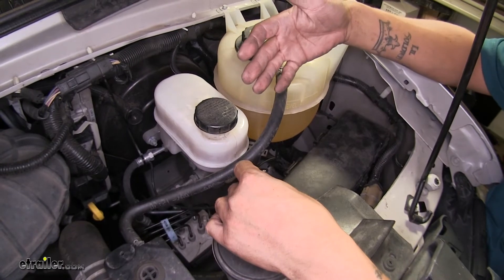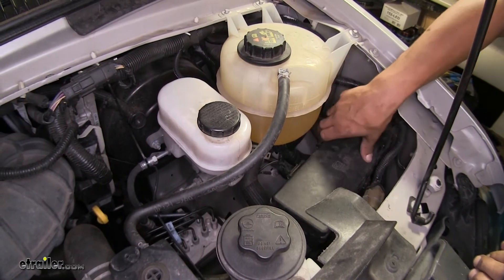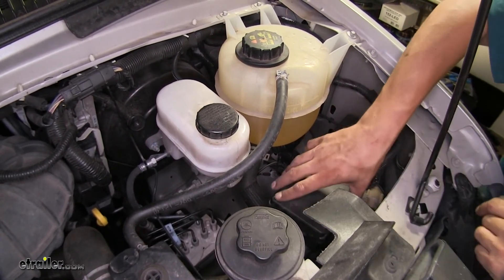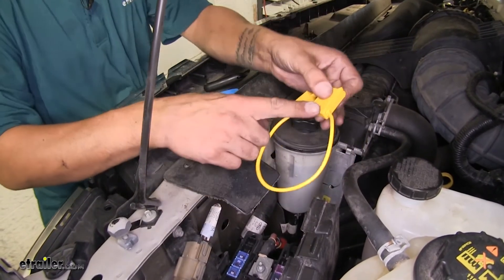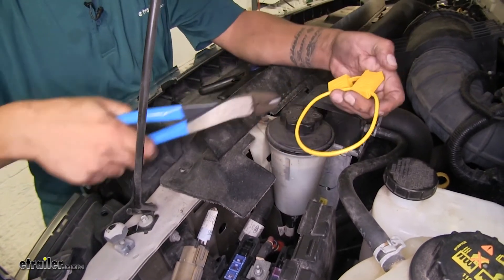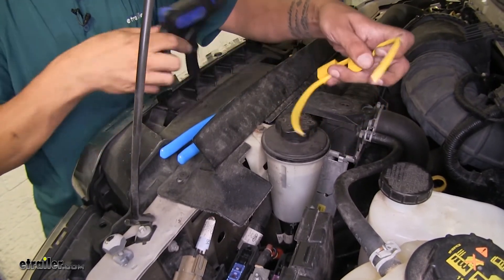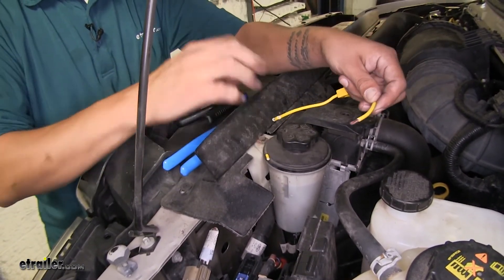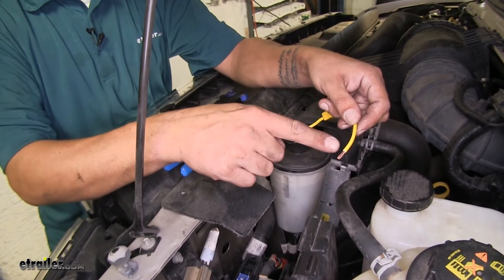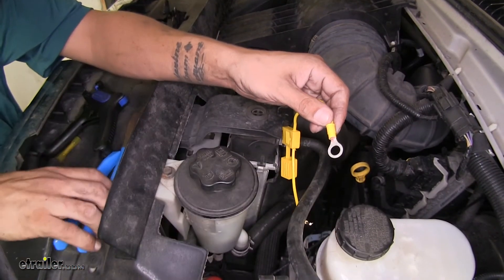The battery is on the other side of the engine bay, but fortunately right here on the very outside front of the driver's side of the engine bay, we have our fuse panel. If we come to these two clips, we can release them, open up the cover, and we'll have a 12-volt power source right here. Before we hook up our wire, we're going to need to put our fuse holder in place because it is a fuse-protected circuit. It's one big loop, so I'm just going to cut it directly in half and strip back both ends. On one end, we're going to put on the provided ring terminal, and the other end we're going to put on another butt connector. Slide the ring terminal in place and crimp it down.